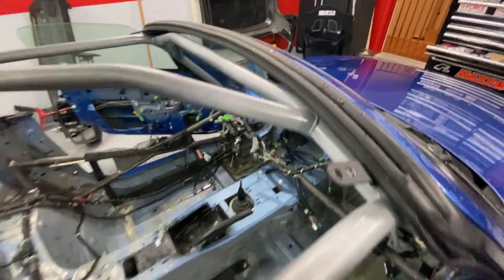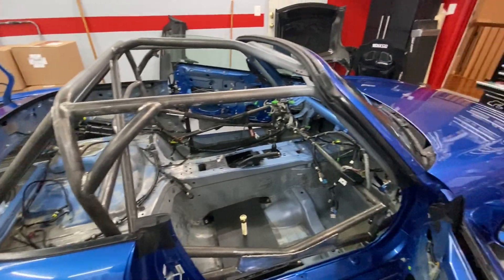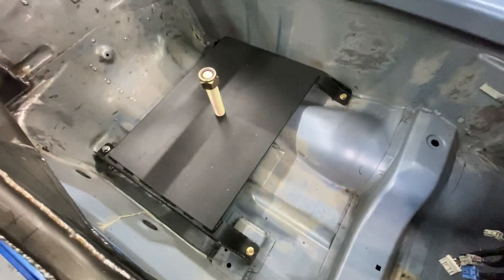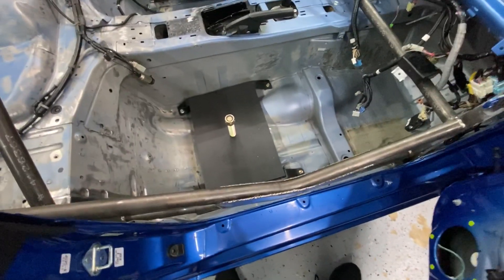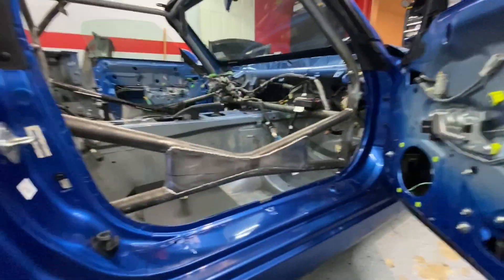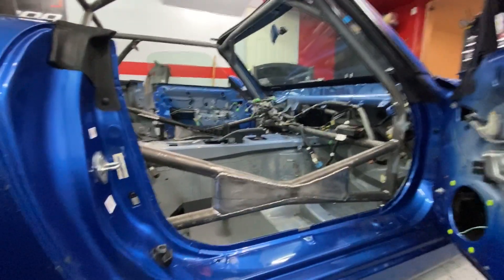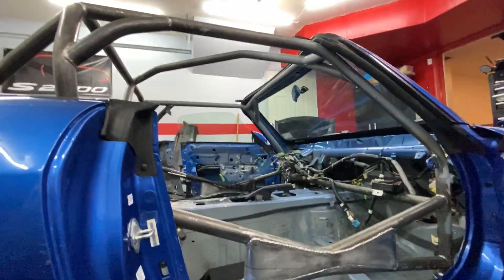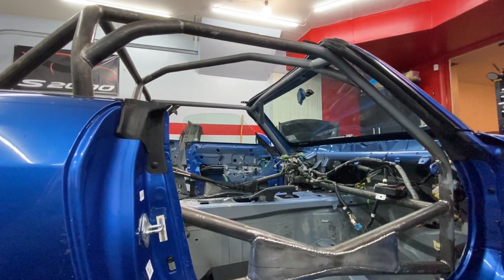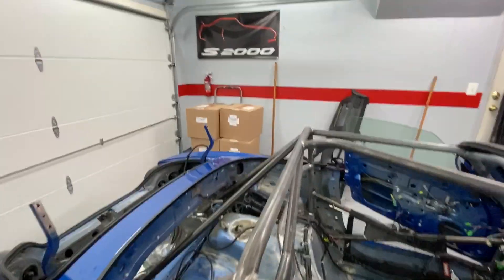Having had both setups, I like this setup better, so that's what I went with. You can see the color the interior is going to be — the whole interior is going to be painted Rust-Oleum Smoke Gray. I'm working on getting all the wiring harnesses taped up; I'll do a little spray this weekend. He also built a really nice ballast setup — it bolts to the stock passenger seat area using stock locations so I can throw a bunch of weight on there. I also did a one-inch bar down on the pinch weld as a center jacking point, so you can jack right from there. With a full cage it jacks up nice and stiff — throw two jacks and done, just to make things a little more practical at the track.